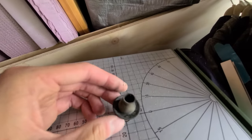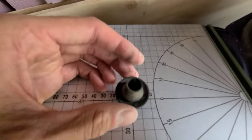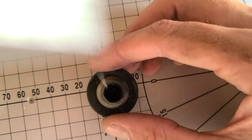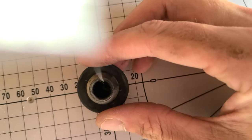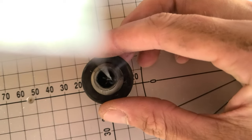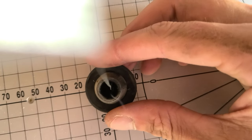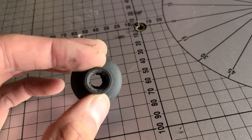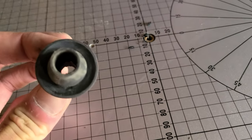I fed the resistance wire through the middle of this, then I'll turn on the wire saw and slowly melt away the material I'm not wanting. With the hot wire saw, I'm effectively widening the interior of the drain, which will prevent the clog from forming in the first place. Cut pretty smooth in there, nice and spacious. With these protrusions removed, the debris should more freely flow through the system, preventing future clogs.